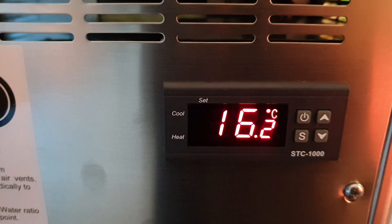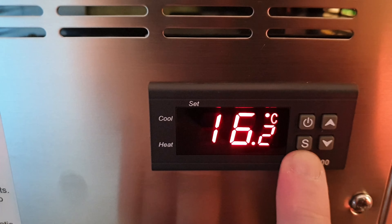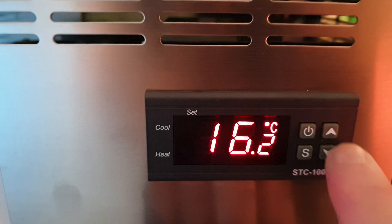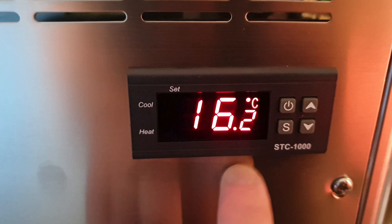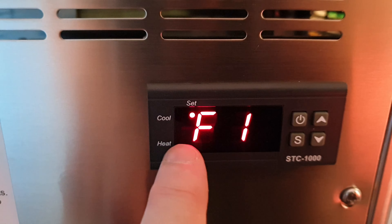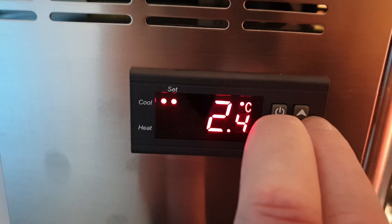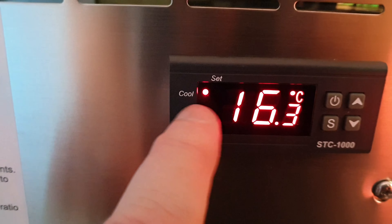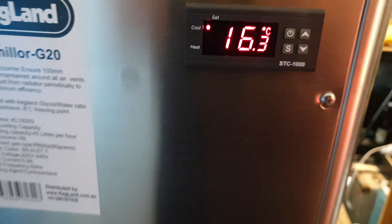When that light stops flashing, it'll start the cooling cycle. To check what temperature it's set at — that's your power button, hold it down to turn on and off. That's your set button. You can tell when you're in set mode because there'll be a light underneath set. Press the upper arrow to check — this is set to 2 degrees. To change it, hold down the set button, you'll enter set mode at F1 — which is the temperature setting — then change the temperature and press the power button to confirm. As I was talking, the cooling mode switched in and the fridge inside is now cooling.